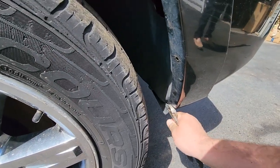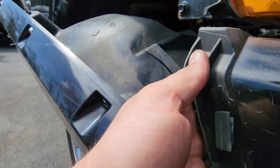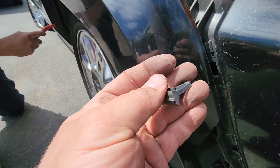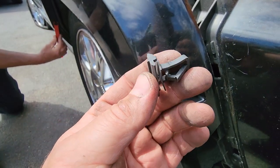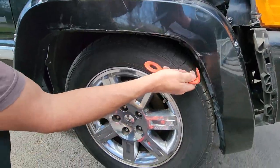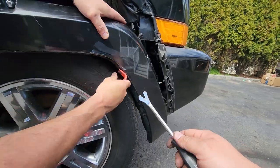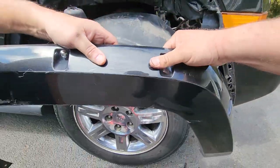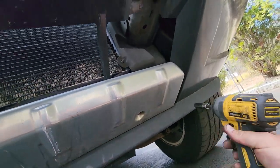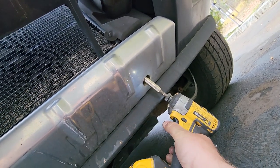We wouldn't have to do this if he didn't smash my Jeep in the first place. Here's a look at the clip — this holds the flare onto the bumper. It's just plastic, so I'll leave a link in the description below if you need to order new ones. We're gonna remove this flare by taking off the rest of these plastic rivets. I've got a metal tool but if you want to use the plastic one it might not damage it as much. Moving down to the bottom — I think it's just two 10 millimeters.